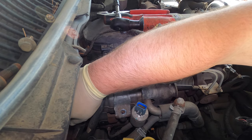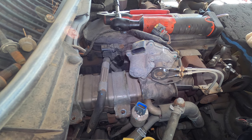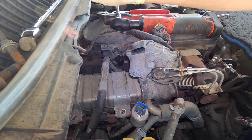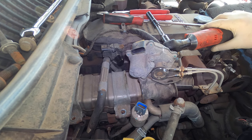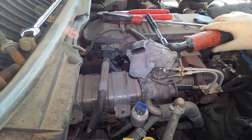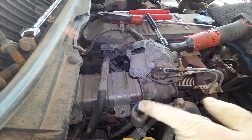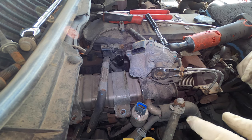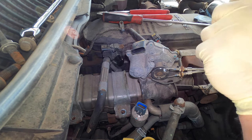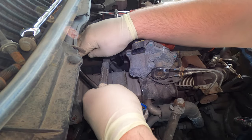I had another truck recently - another Dodge Ram - that came in with lack of power, same 6.7. The problem with that truck: it had turbocharger codes, obviously low coolant, overheating. What I noticed was the water pump was leaking and the exhaust gasket on the EGR cooler was blown out so bad it was actually spitting coolant on the firewall because the EGR cooler ruptured. Again, I believe the main failure was the water pump causing the EGR cooler to rupture because the customer didn't care about the coolant level.